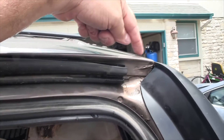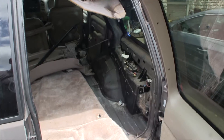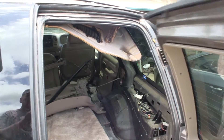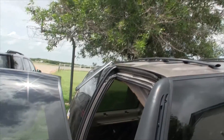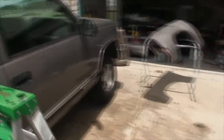So if you've got a leak on a '97 Tahoe or Suburban — or around that era — and you think you're leaking around your back windows, check your brake light holes. I already checked and all the LEDs still work. I'm going to seal those holes up with silicone, stick it back down, and put the luggage rack back on. Problem number one solved.